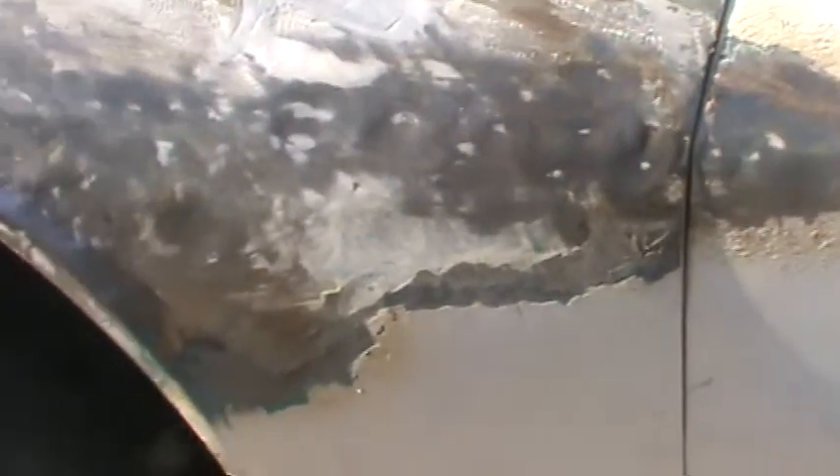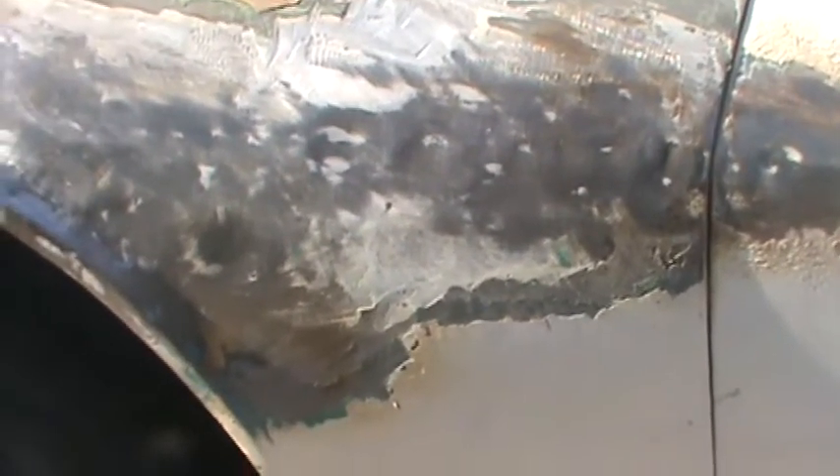Well, I stripped this back far enough. Doesn't look to me like there's any kind of body line — there's a little bit of one in the door, but I can't really see anything in this fender. Taking a look at the other side, for sure there's a body line here, and this fender was a replacement fender, so I'm pretty sure that's what it's supposed to look like. I'll just have to use my best judgment on it.